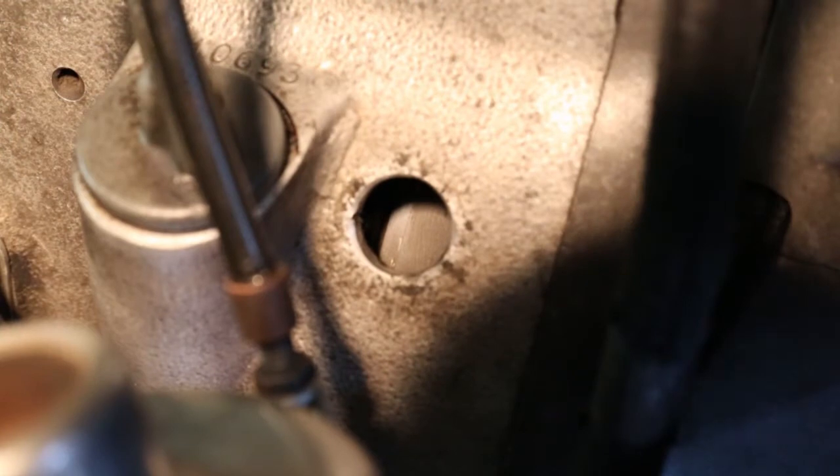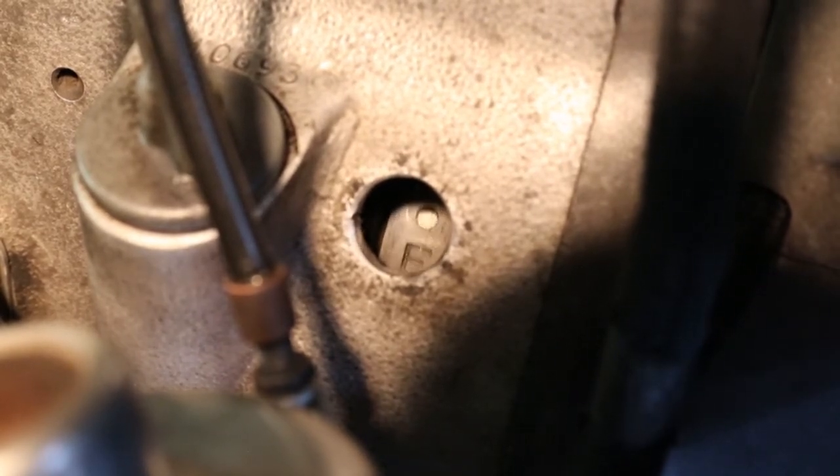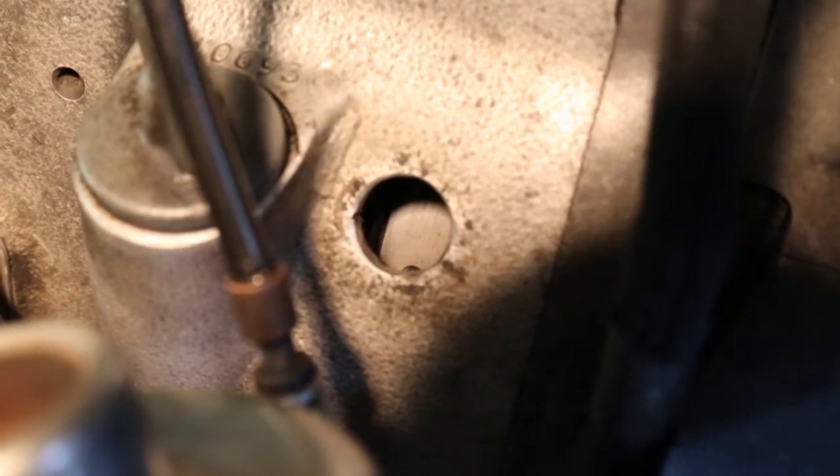I happen to have shoved it into a roll pin put through the cooling fins just here — that stops the cooling fins ringing when the engine is running, but it's a handy hole for my black probe. The buzzer is now fitted across the points and the points are closed, so you can hear the buzzer buzzing away. I'm going to turn the engine clockwise and we should see the F and the white dot come past first.